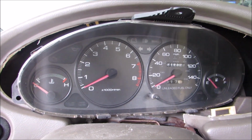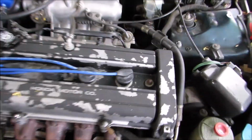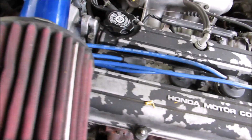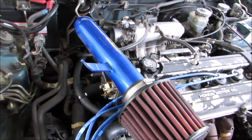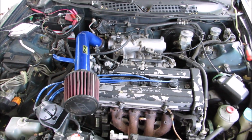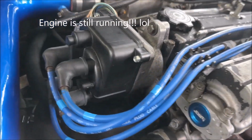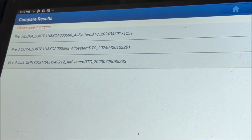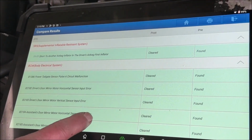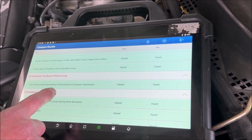So what he wanted to do is fire it up and then see if we could get spark. I thought we had spark before at my house when we tested it. I don't know if we did or didn't, but right now we're getting no spark. So we want to find out if there's something electrical going on before we start taking things apart and messing with stuff. It's probably better to diagnose it now. But basically, he asked me, since it wasn't running, did I try the distributor? So I actually went home, got another distributor, and the engine fired right up. So I probably could have been driving this car, not even have it towed. I just didn't try the distributor, so you live and learn, but I feel a little silly.